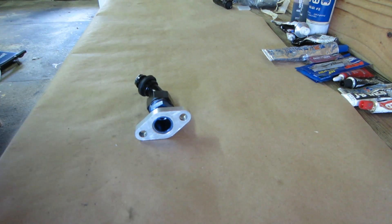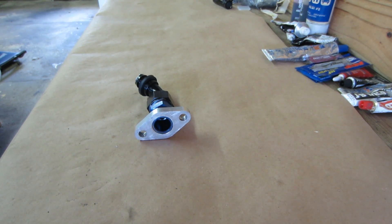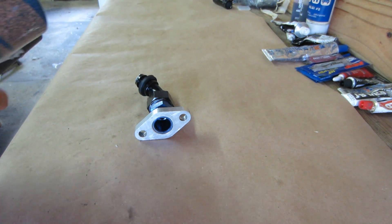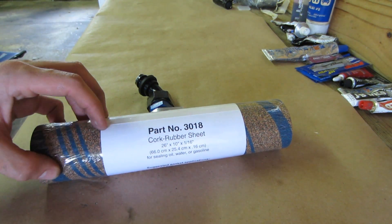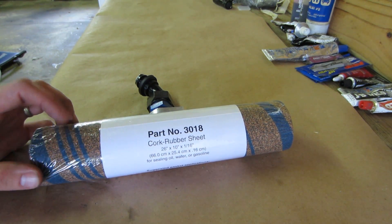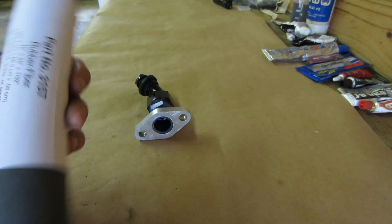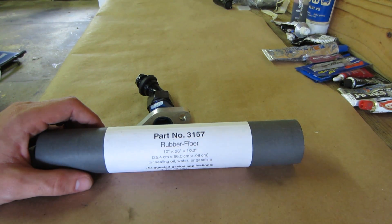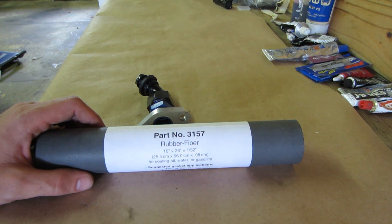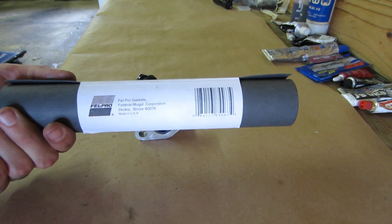When I took this adapter off, the gasket was very bad — it was actually leaking out of one side, which caused it to get moist and peel off. So we're going to make a new gasket. You could order another one if you need to, but I chose to go to the store and get gasket material. They make a cork gasket material, but I read it gets hard and cracks when heated, and being on the CHRA of my turbo it's definitely going to get hot. So I'm using a rubber fiber material instead — that's actually what normally comes in a stock drain line kit that bolts to the bottom of the CHRA. This was picked up at the local hardware store and you can make whatever gasket you need with a razor blade.